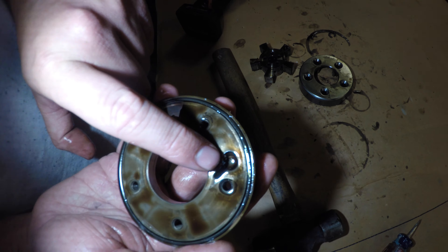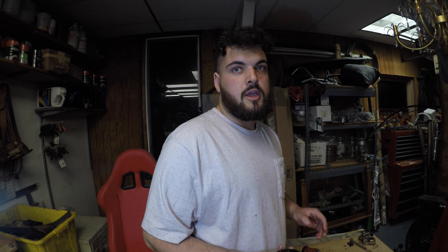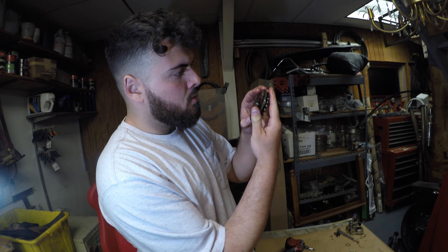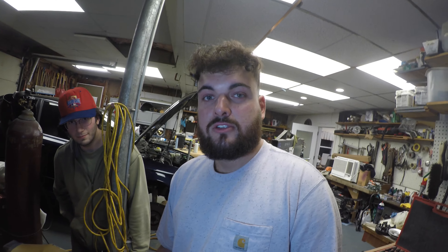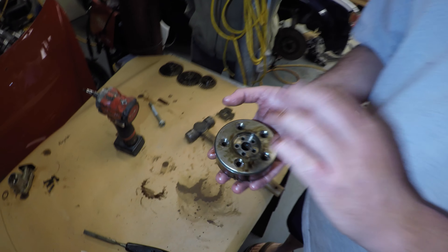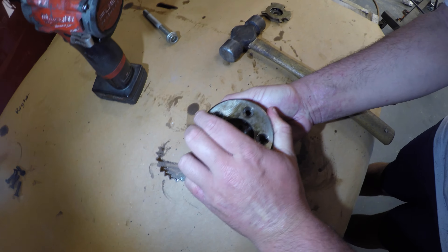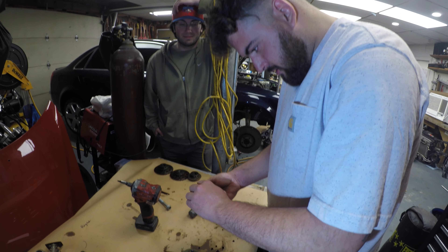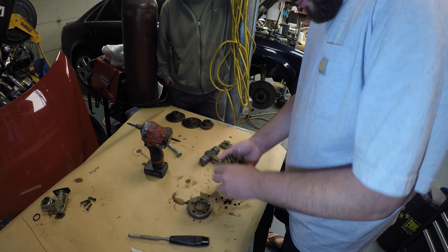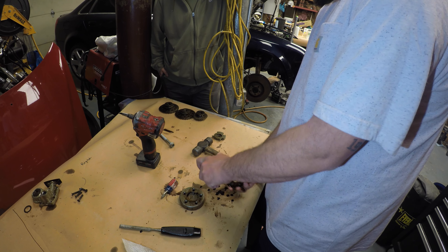With these Audis there's a pin right there, and then there's the big main pin right there. On these phasers, over time the pin on the back side — the hole — can get worn out. As you can see, if Kai rotates that, you can see there's just enough movement to just not work properly. Even just that little movement right there. It's supposed to be a perfect circle. Look at that — you can see it's all worn out right around the edge here. Yeah, it's taken a good beating.